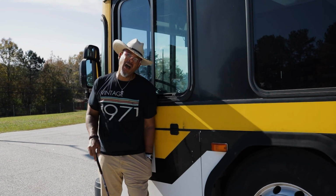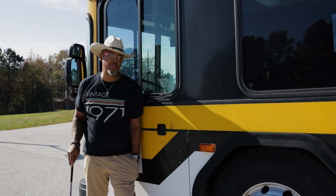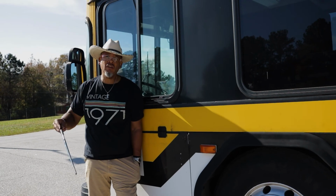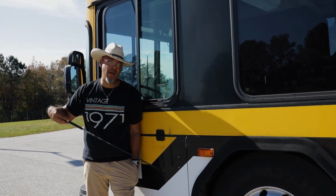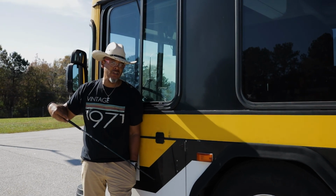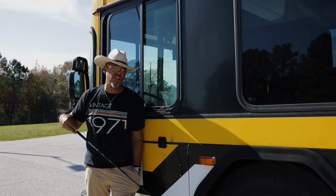And I have a tie rod down there. That tie rod is properly mounted, secured, not cracked, bent, or broken, all hardware is present. So that's all of my steering linkage. The steering linkage, I have to make sure it's properly mounted, secure, not cracked, bent, or broken. Because when I'm steering this bus, it's important that all that steering linkage is there.